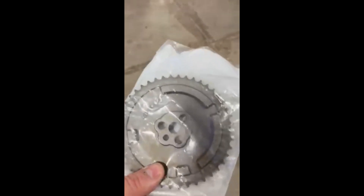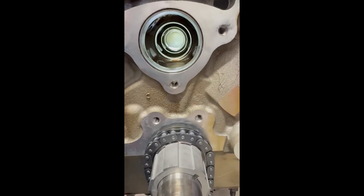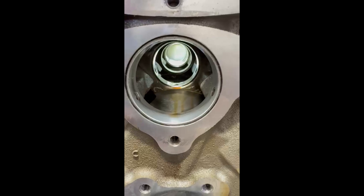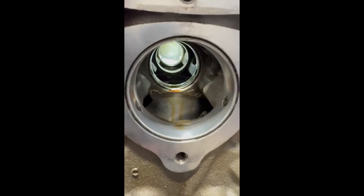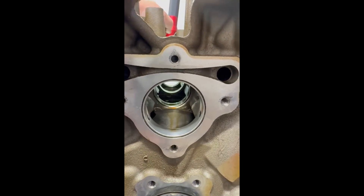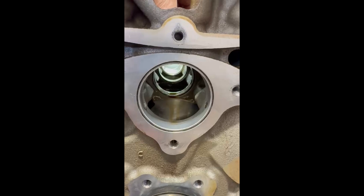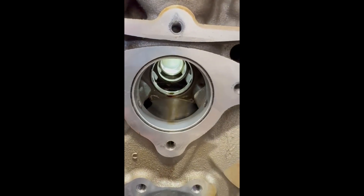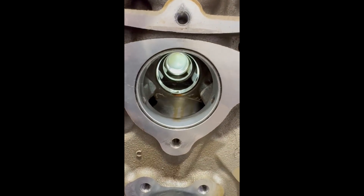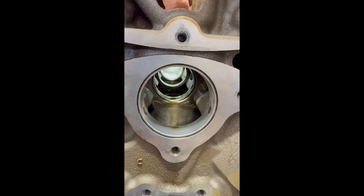The lugs are still in the same spots, it's just that they have a three-bolt deal that goes in the front, kind of like your old-school ones, and they are ARP bolts that they send you. Before we install this cam, I just wanted to show you the cam bearings in here. The back is sealed up. I got a light in here so you can see it. Sometimes when you go to remove these cams they stick and you can't get them out. The third one back is the one that the cam was sticking on — the very last part of the cam that rides in the back bearing was hanging up on that third bearing.